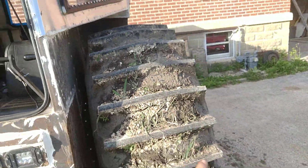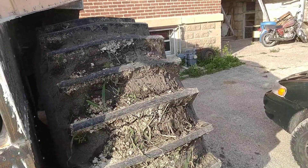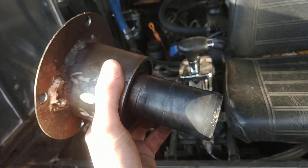It slammed down and the front left got most of the brunt. The frame rail panel basically beer-canned the chain cases right there — you can kind of see it. About 10 seconds later there was a bang, and all my exhaust gases deflated out of the tires. On the front left, this exhaust stub that goes into the coupler snapped off.